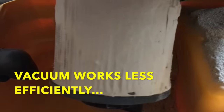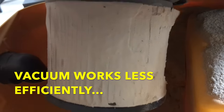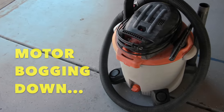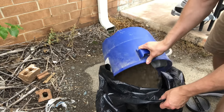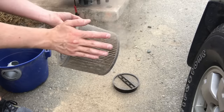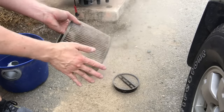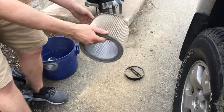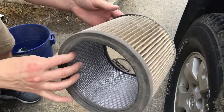Furthermore, as the filter clogs, the vacuum works far less efficiently — you'll hear it bogging down and struggling as the tank fills with dirt and dust. To counteract this, most people dump out their tanks often and then knock out their filter by hand. And just look at the stuff that comes out — it's like clouds of spores. If you do this indoors, clearly it's going to find its way onto other surfaces. But even if you do it outdoors, the filter still retains much of it.